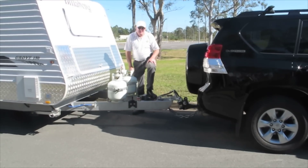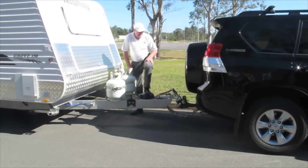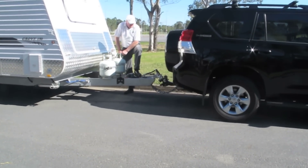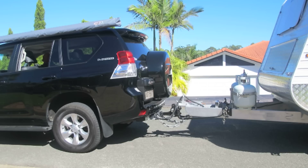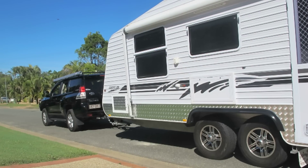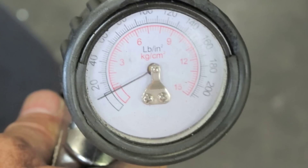Just watch how the vehicle's rear suspension bounces without the assistance of the Polyair bags. Now with the Polyair bag inflated at 20 psi, the coil compression is significantly decreased and prevents the bounce, providing a firmer, smoother ride when towing. And just as importantly, when you are not towing, the Polyair bags can be deflated to 6 psi and you regain your normal, smoother ride from your suspension.